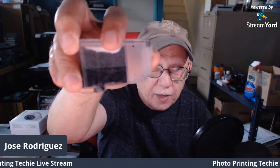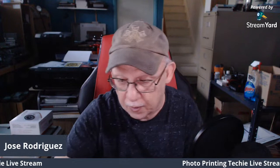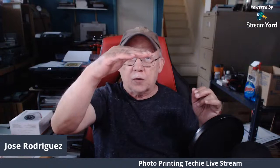You got to make sure. You see that white upper space here? Not the top, that's normal OEM results. But that half of the sponge has a different density. When you refill it, it may not absorb ink properly because it was allowed to go empty. But when we start off with a flushed cartridge, it will saturate all the way to the top.